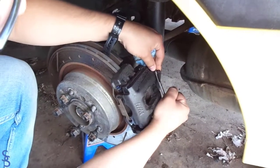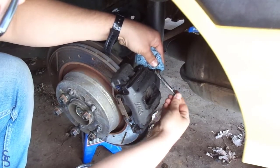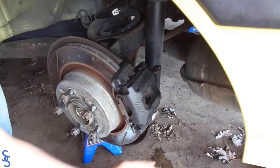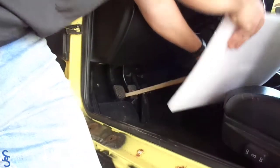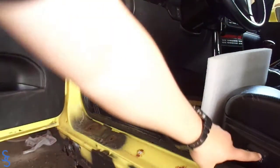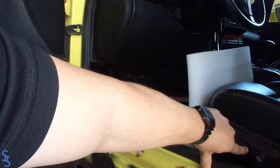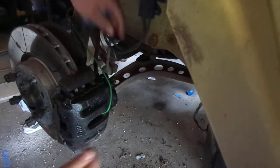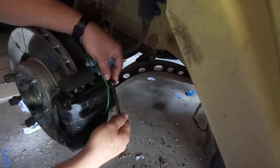With the brake pressed, open up the little bleed screw to let some fluid out, like this. Then after some comes out, just close it. Go back and pump the brake again. As the pedal goes further down, you can use the seat to put some pressure on the brake, just like this. Repeat this process until the fluid shoots out due to the pressure that you're building in the system.